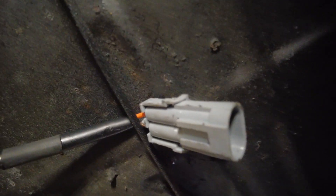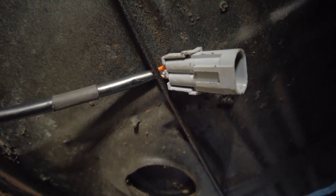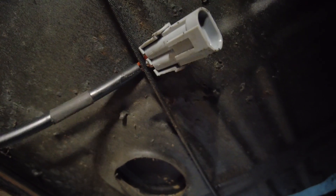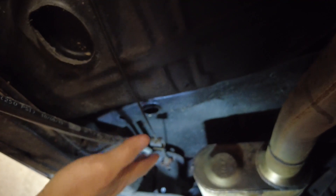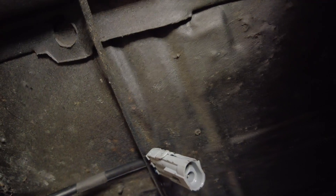This is the end of the fuel pump harness. It's kind of tough to tell, but really we're about on what would be the floorboards or footwell of the back seat if this were the station wagon instead of the El Camino. That means we have about another six feet to go to get all the way back to the fuel pump. We'll have to see if they have an extension harness for that; if not, they do give us the connectors and we'll just make one up and extend the wires back there.